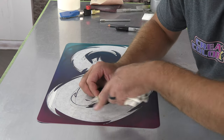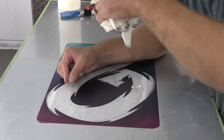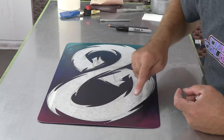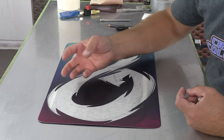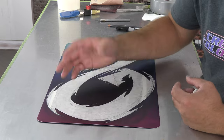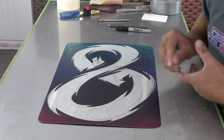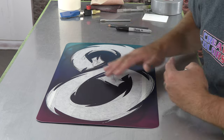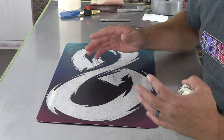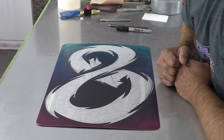When I spray, I'm going to mix 4011 in with our Autoborn Silver Sealer. The Silver Sealer covers fantastic, and because it is light, when I spray I'm just going to kind of follow the edges. I'm not super concerned if some of this candy color bleeds into the silver a little bit — it's going to be a lighter shade and that's all I'm trying to do: help punch this number out and push the rest into the background. That's the beauty of something like this where I'm not trying to do a white line over blood-red candy. I'm going to set this up on our stand and show you guys how I put down the Silver Sealer.